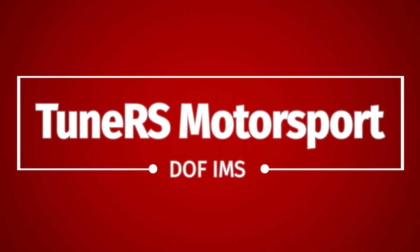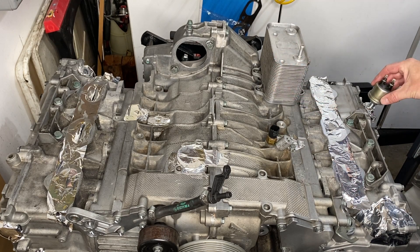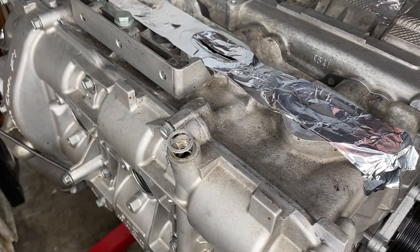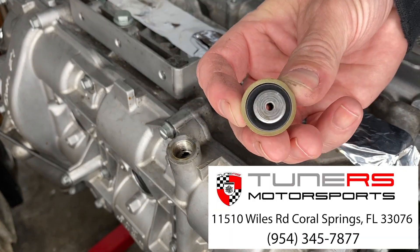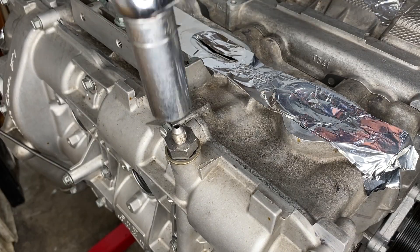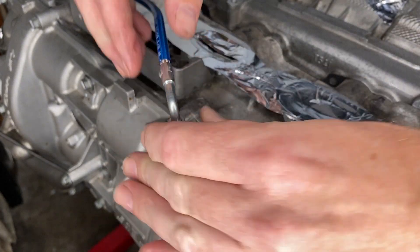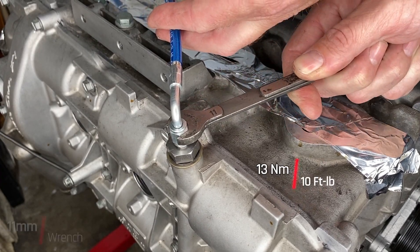It's time now to put the other part of our direct oil feed together. You can see the oil pressure gauge on bank two there, and on bank one there is the same sort of port but it's blocked off. We're going to open up that port and use it to feed this little adapter that came with the kit from Tune RS Motorsports. That's a 19 mil to attach that, and the red thread locker came with the kit as well. This is the actual pipe that feeds the oil to the IMS bearing — that's an 11 mil on there.